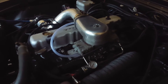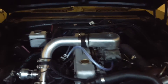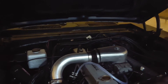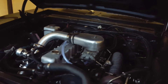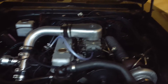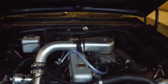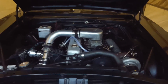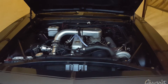The carburetor — I don't care to tune it as often as I do, and I don't want to tune it every time I think about playing with the boost. I was warned and cautioned by many before I did it, and now I find myself thinking it would be nice to get an electronic system of some kind. The carburetor is wonderful — I love it, I think it's great, I like the looks of it in the car. Holley 600 double pumper, beautiful carburetor. Works really well when adjusted, but the weather conditions, altitude adjustments, and constant playing around with it — it's just not for me. I just want to drive the car.